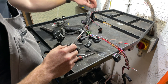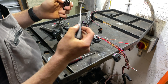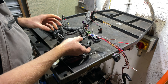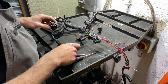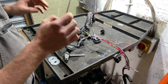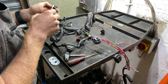A screwdriver can be used, but what you must never do is lever a screwdriver in here because you'll just snap it off, and once that's done it's very hard to undo — it's a bit of a flawed design. These D-shaped connectors are not only found on Volkswagens; they're also found on Fords and all sorts of other cars, and are quite common on wiper motors from all manufacturers. That covers pretty much every situation with a stuck connector and shows you why you shouldn't lever back with a screwdriver — it will just apply too much force and break it.